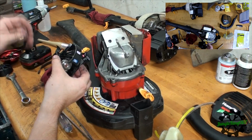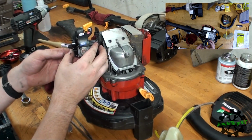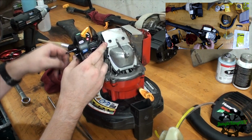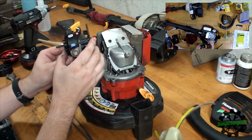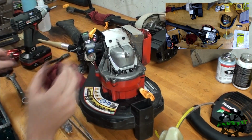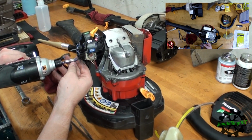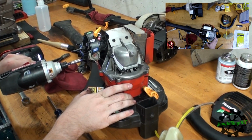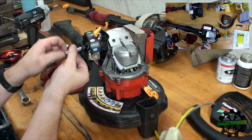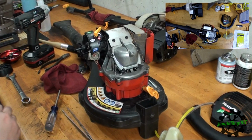Got those two bolts. I'm going to go ahead and run them through the carburetor and everything else in between, and slide this back in and attach it to the head. Make sure these things aren't too far out, or else I'm not going to be able to line them up. Line that one up, and that second one. All right, that feels good enough.